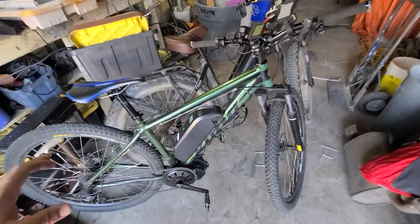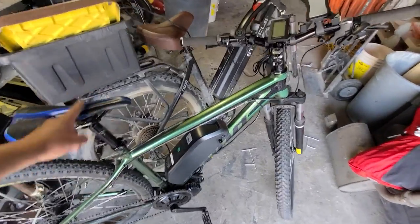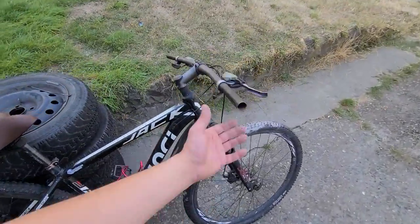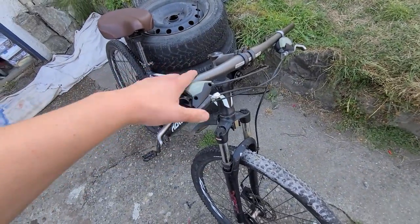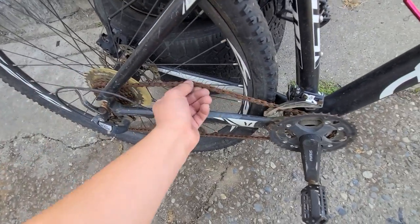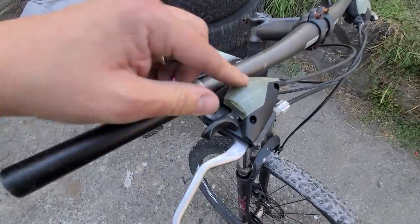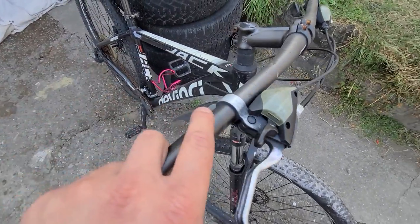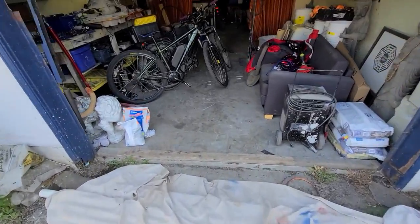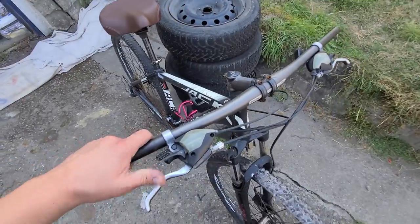In the next video I'm going to be putting the 750-watt Bafang kit on the other bike — a 750-watt with a 20 amp-hour battery — on the DaVinci Jack. I have to do a little bit of work to this bike before the install: I need to change the shifter, the bike sat outside and got a bit corroded and rusted, so I might as well change the chain and maybe the derailleur before putting the kit on. I was hoping to get both bikes built this weekend but it's taking a bit longer than expected, so hopefully by next weekend I'll have both built.